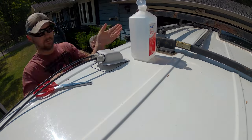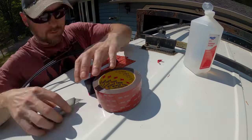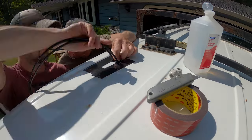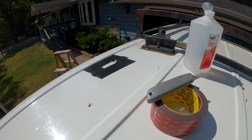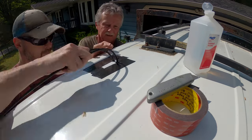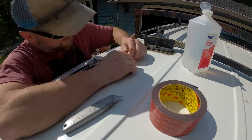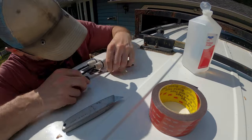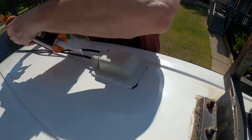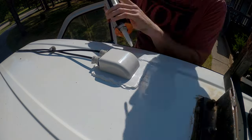Now, I'll route my cables down through the hole to reach my power center, where these will connect to my DC-to-DC charger in the next episode. To attach this wire entry piece to the roof, I'll use 3M VHB tape — VHB stands for Very High Bond, which basically means it has a lot of holding power for an adhesive tape. Finally, I'll lay down a thick bead of Sikaflex 715 around the top for a waterproof sealant.